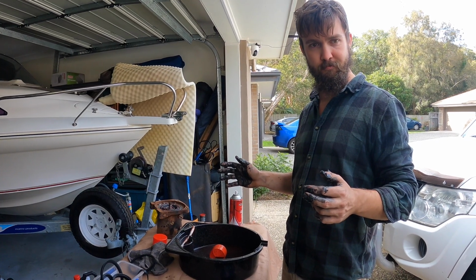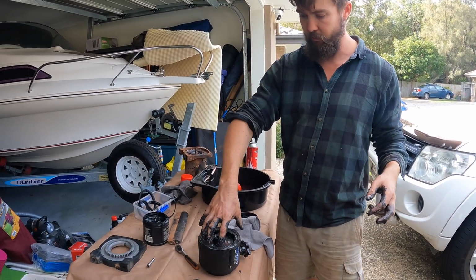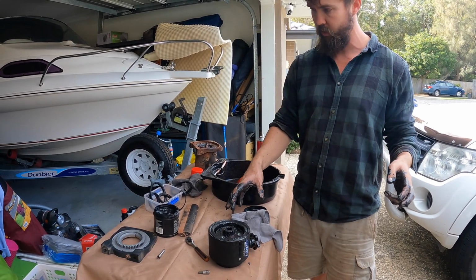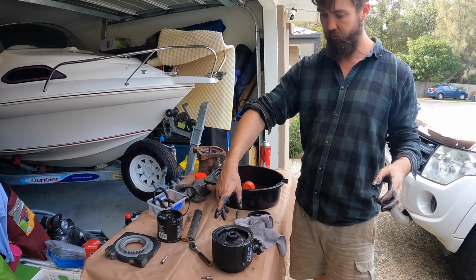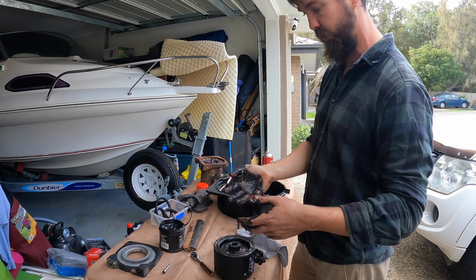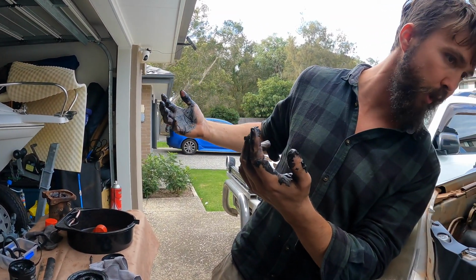I feel like Justin's not sure what he's doing next. No, when you do these, you can rotate. The cool thing is you can rotate the housing, so your clutch is in an accessible place for each different car. But what I should have done is mark where they sit in reference to each other, so then I know where my clutch needs to be when that's bolted up. I might just have to pull it apart and do it again. No drama, but mildly inconvenient.